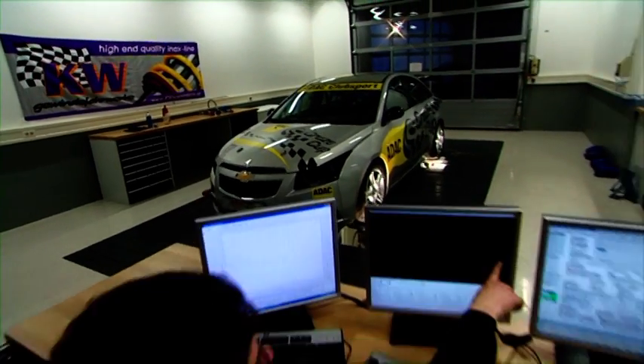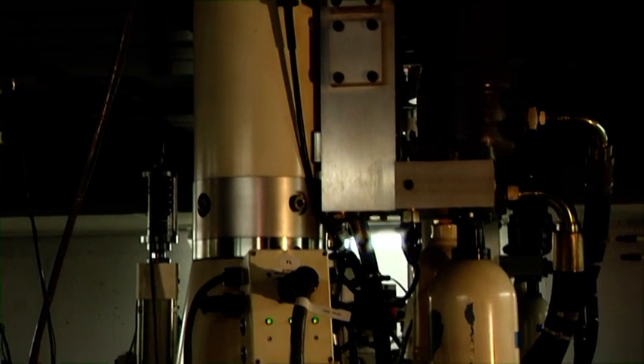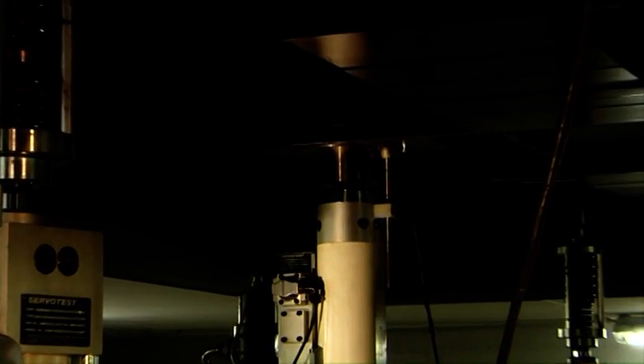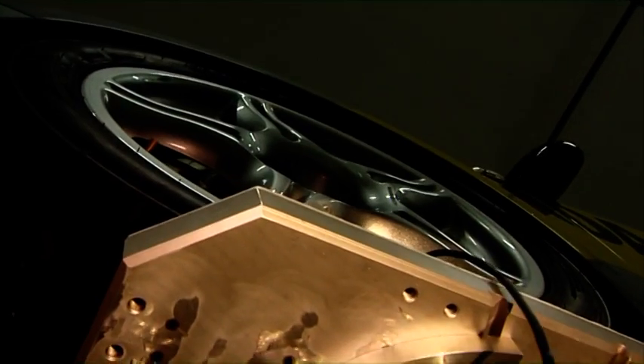A race car can be appropriately set up in advance without being on the track. The sensors on the wheels record their vertical acceleration. There are also sensors on the chassis structure at the front and back to record the spring level. In addition, a load cell on each post shows the strength of tyre contact, along with acceleration and travel sensors. From this data, the various parameters and graphs can be created.